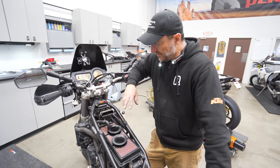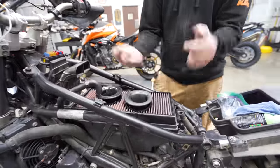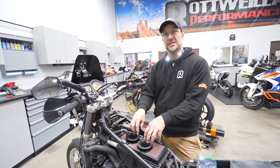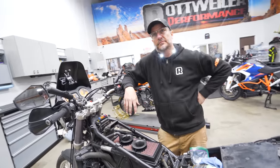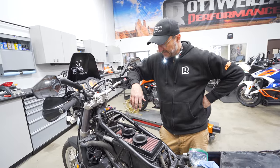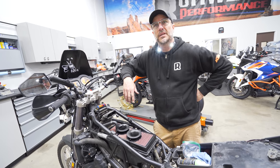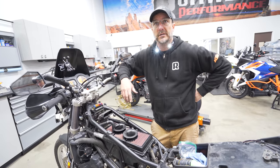So basically what you're looking at here is the way the intake works — it's really unique where it actually pulls air in through these two small holes here, brings it out around the carburetors, up through this filter, and then back down into the velocity stacks. When air has to change all these directions you start losing velocity. The secret to ours is because we have a filter right above the throttle bodies breathing from the top, it's literally pulling clean air straight into the velocity stacks. So some of the secret to horsepower is that we're not bouncing air molecules all over the place and slowing things down. It probably heats up a little by passing through, but it seems negligible. With our system it's a lot easier to work on, you shed a couple pounds of weight, and you make a lot of horsepower — it's a win-win-win-win-win.